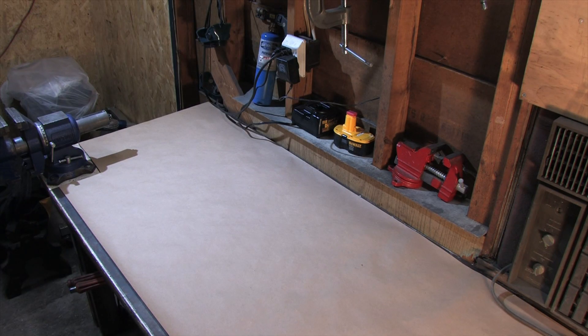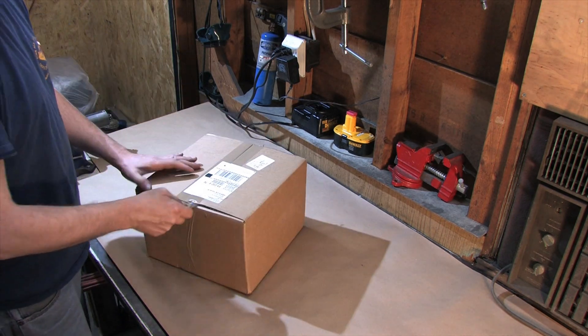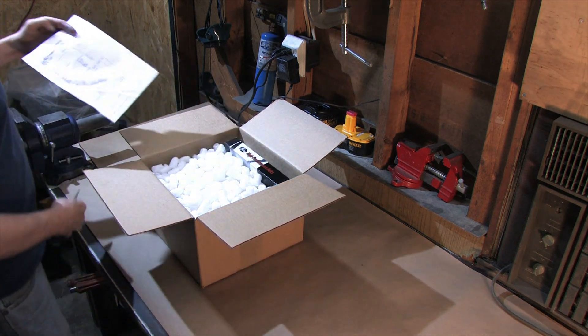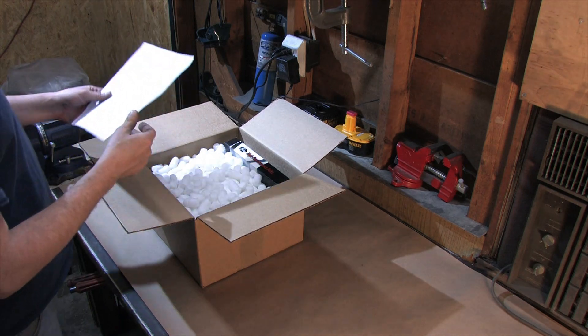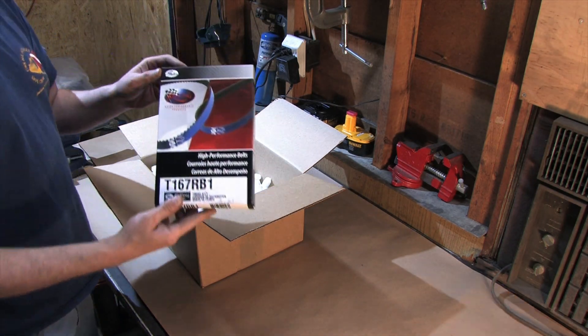What I'm about to show you are all the parts you should replace when doing a timing belt job on a 4G63 engine. My timing parts are specific to an 89 to 92.5 6-bolt, but I've listed the 7-bolt part numbers wherever they're different. Some of them are the same even though the 6-bolt and 7-bolt engines use different water pumps, front cases, timing mounts, and tensioner assemblies.